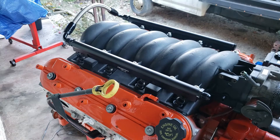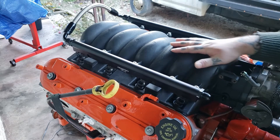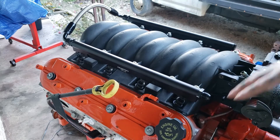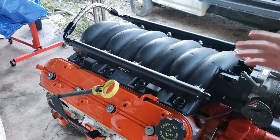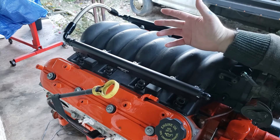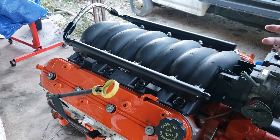I hope you enjoyed this short how-to video — it wasn't extremely lengthy, but it's pretty simple to bolt an LS1 or LS6 intake down onto your LS engine. You just want to make sure your gaskets are lined up and your surface is clean. If you've got any leaks or distortion, just use some RTV silicone. If you're new, show your support by smashing that subscribe button, leave a like, and drop a comment if you found it helpful. Thanks for watching and I'll see you on the next one.